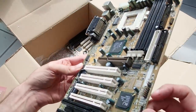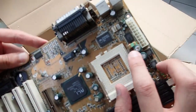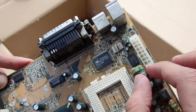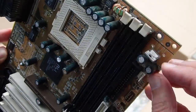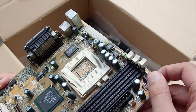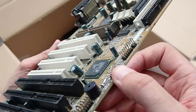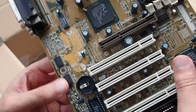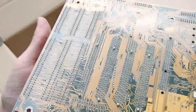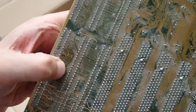This is an interesting one — a Super Socket 7 mainboard based on the ALi Aladdin 5 chipset. I already see problems: bent pins, ripped-off and blown capacitors, all needing replacement. On these boards, manufacturers used the cheapest capacitors ever, making this a very common problem. Someone also stole the heatsink from the voltage regulator, which gets quite hot and definitely needs to be replaced. The BIOS ROM is missing as well. The back looks okay but is very dirty — I'll need to clean it first and take a closer look.